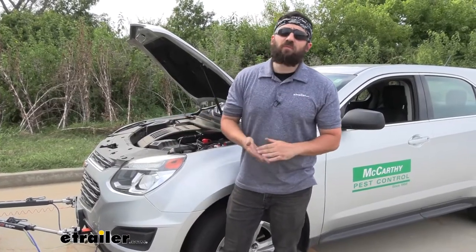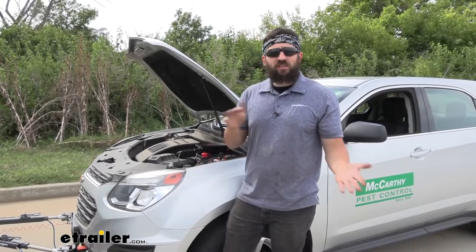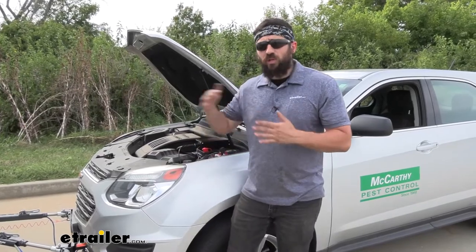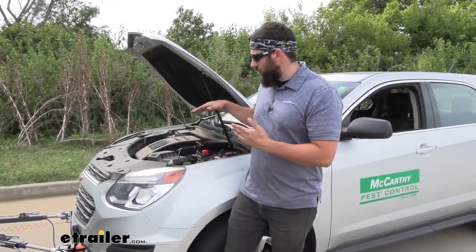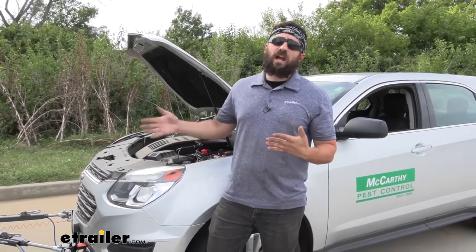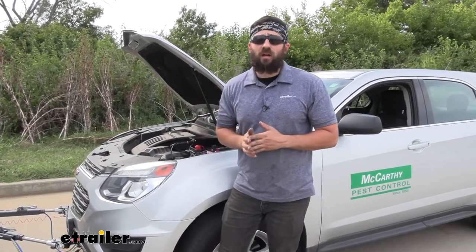The Stay-in-Play is proportional. If you've ever towed a trailer with electric brakes, you may be familiar with brake controllers — proportional and time-delayed — so it's kind of the same theory. The proportional design means we're not going to be locking up the brakes in our towed vehicle. We're going to be applying a force proportional to our travel in the motorhome. So if someone cuts in front of us on the highway and we're slamming on the brakes, we're going to be sending quite a bit of force to the towed vehicle's brakes. If we're just coming to a slow stop at a stoplight, we're just going to be sending a small amount of pressure. The G-Force controller is going to sense the motion or velocity of the motorhome and apply the brakes appropriately to come to a safe, smooth, and effective stop.